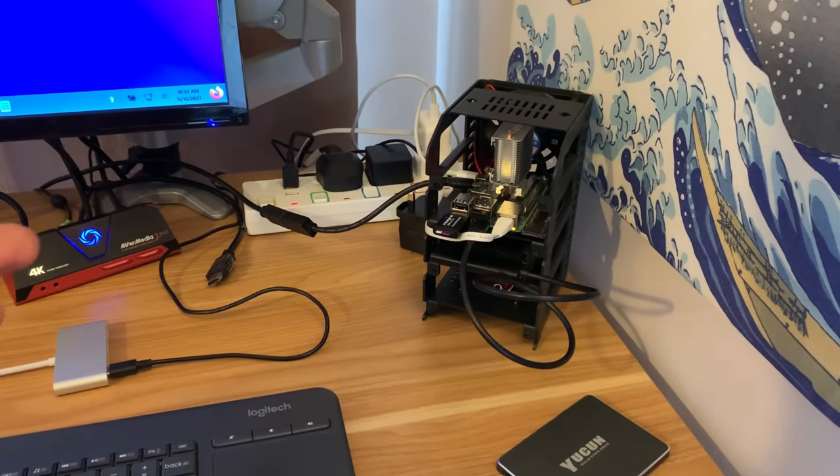That's much better. So after 9 full tests, because if you do a test and it fails, it tests it 3 times anyway. But I did the same process 3 times. Every time it failed. And it's weird because the sequential write speed was quite reasonable, 25,264. The random write speed was all right as well, 2,350. That's more than 4 times what it needs to be. But the random read speed was the one it failed on every single time. So 1232 there. You can see here 1203, 1237, 1232,